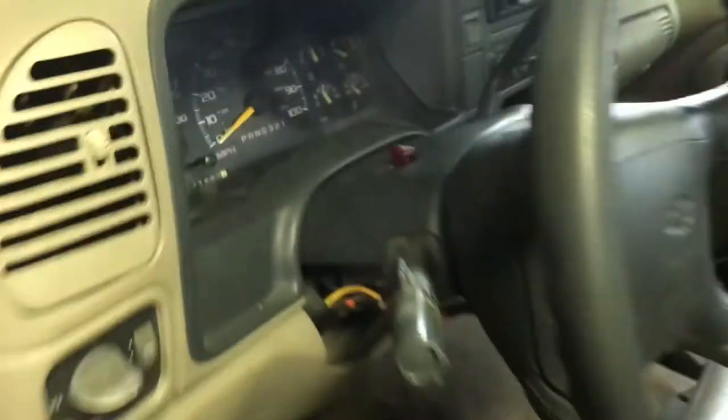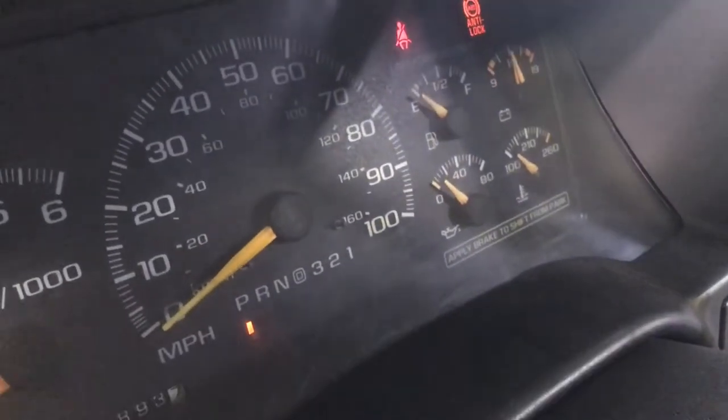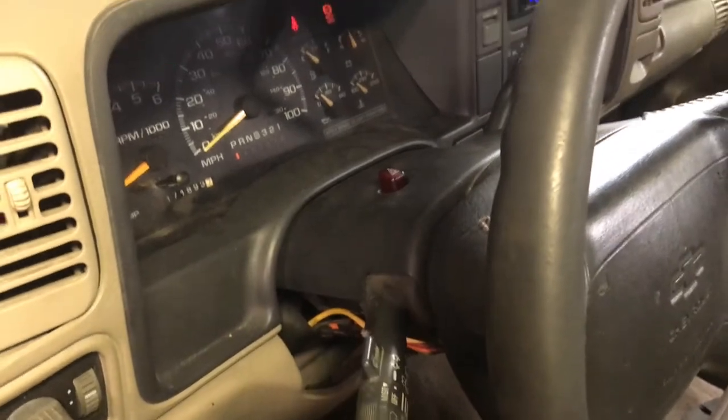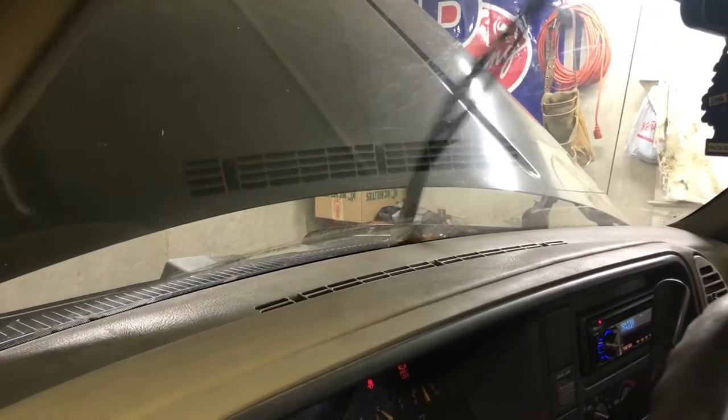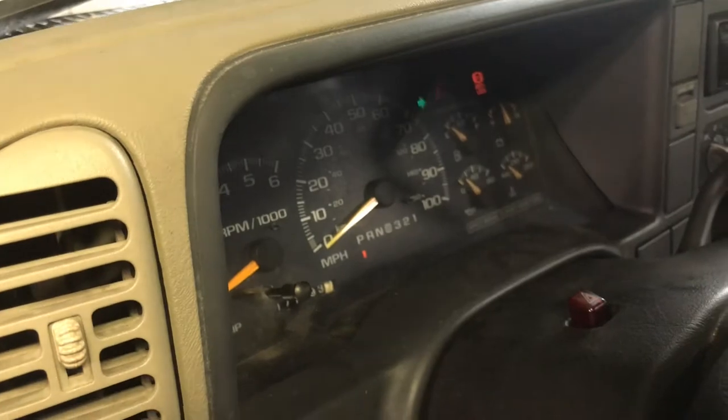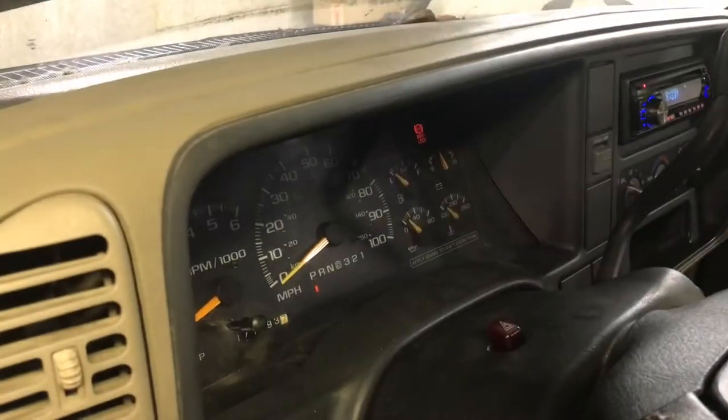Let me explain something. During my initial tests powering up the harness — when you turn the key forward the voltage gauge works, all gauges come on, it says we're in park, the buzzer buzzes, radio comes on. But watch this: when I turn on the left turn signal, the wipers came on. Same thing with the hazards — turn on the hazards and the wipers come on. The right turn signal seemed to work fine, and turning the wipers on directly worked fine too.